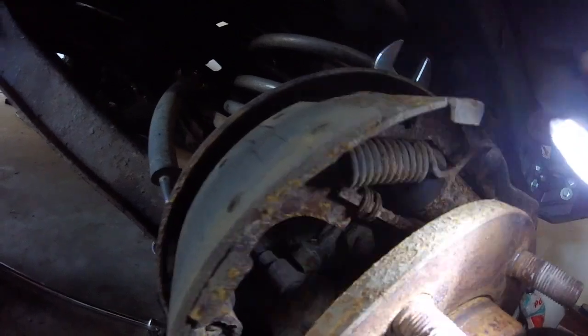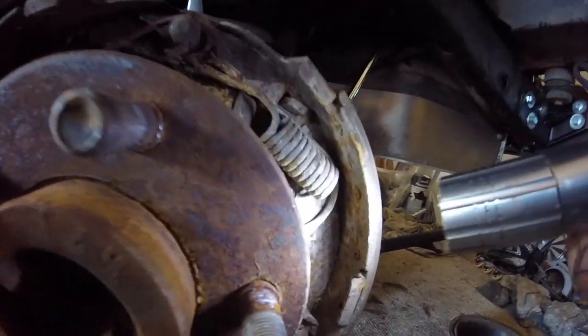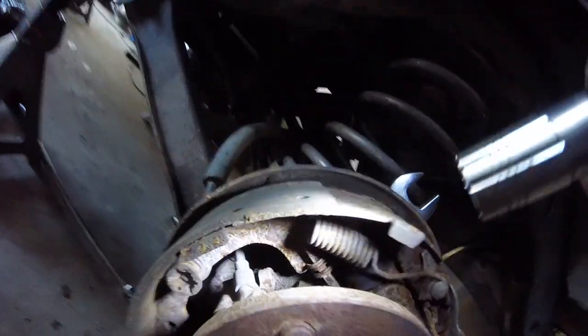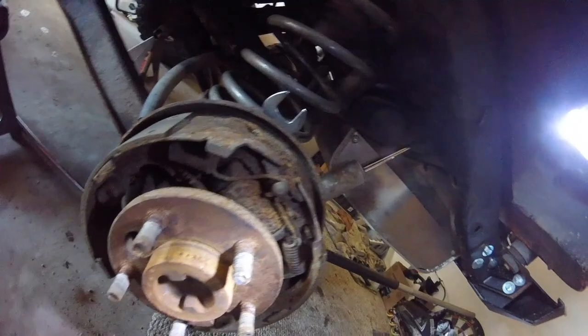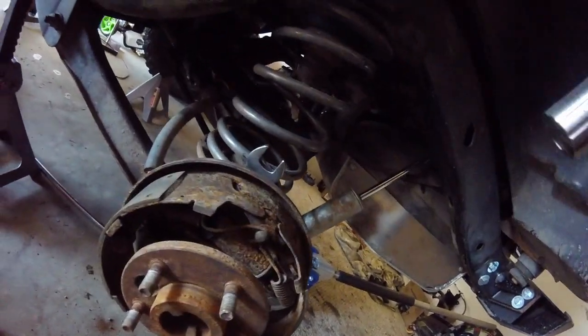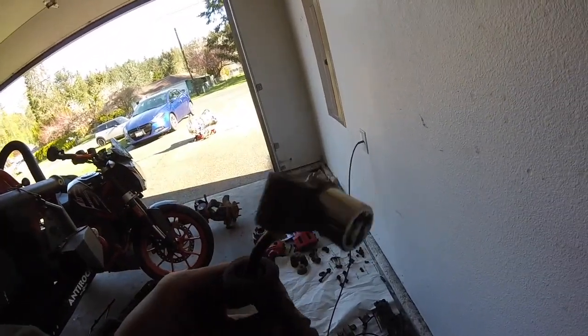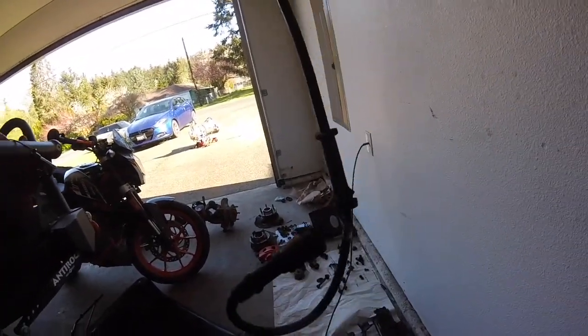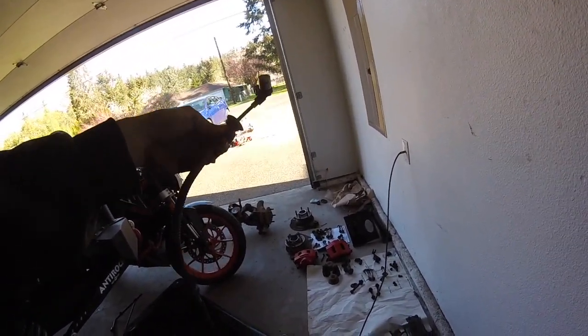Here it is in the drum — I wasn't sure if I could push it through that hole. You'll see on the hub there's a hole you can rotate around to remove bolts if you want to actually pull the axle shaft. I was hoping to just remove the ABS sensor and push it through, but the way I was trying was wrong — you cannot push the sensor through that hole. You have to unplug it at the plug down by the upper control arm and feed it all the way back through. That's the only way to get it out.